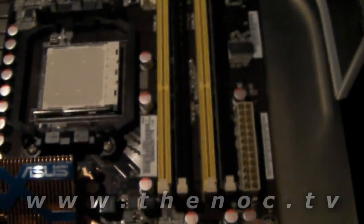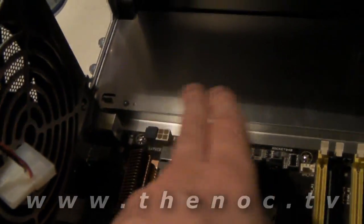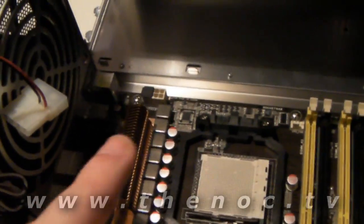As you can see the screws are now in their respective slots — holes or whatever you want to call it — and they have been tightened down. When you put these screws in, the first thing you want to do is loosely put them in so they're all in their spot, that way the motherboard is all situated. Then you go back through and tighten them down. Just like with the standoffs: put them in, make sure they're in the right spot, then tighten them down.